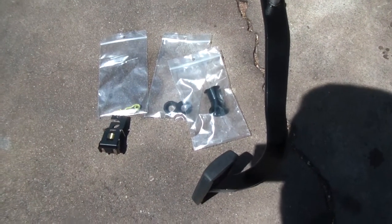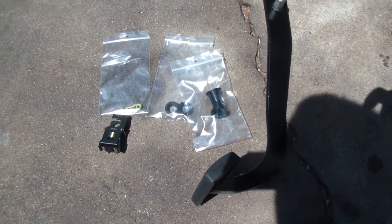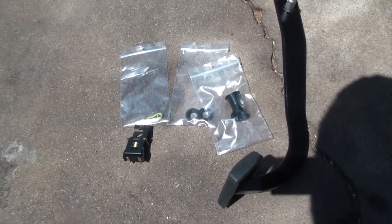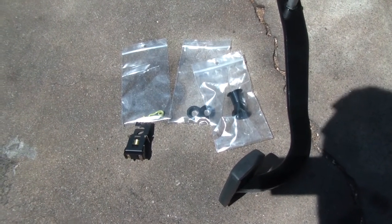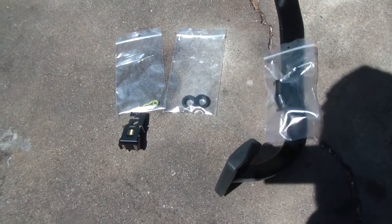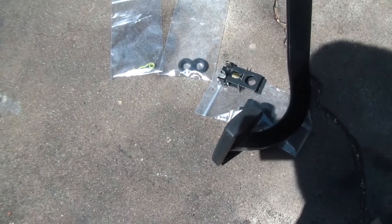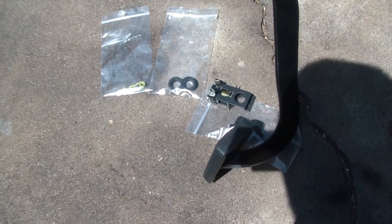What's up — I thought I'd show you guys my early Bronco brake pedal conversion. I have a 1966 Bronco, and in 1966 I think it was the only year where the rear brake lights were actuated by a pressure switch and not an electrical switch like the one mounted on the brake pedal lever that all the later Broncos used after '66.